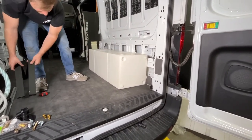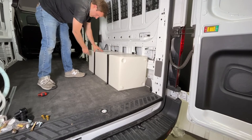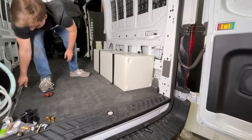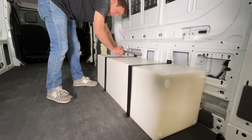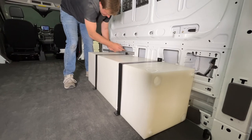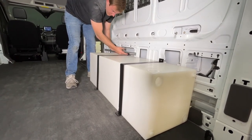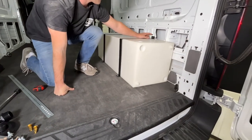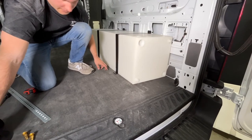It comes with brand new straps. In a situation where there's a gap in the strap, we like using a pre-punch — it's just a Home Depot 3/8 pre-punch. There's already a welded-on nut here so it works perfectly; you can just use the current weld-on nuts and put a new 3/8 bolt there. The bolts that we provide work well in a situation where you're going straight into the body here or down into the floor.